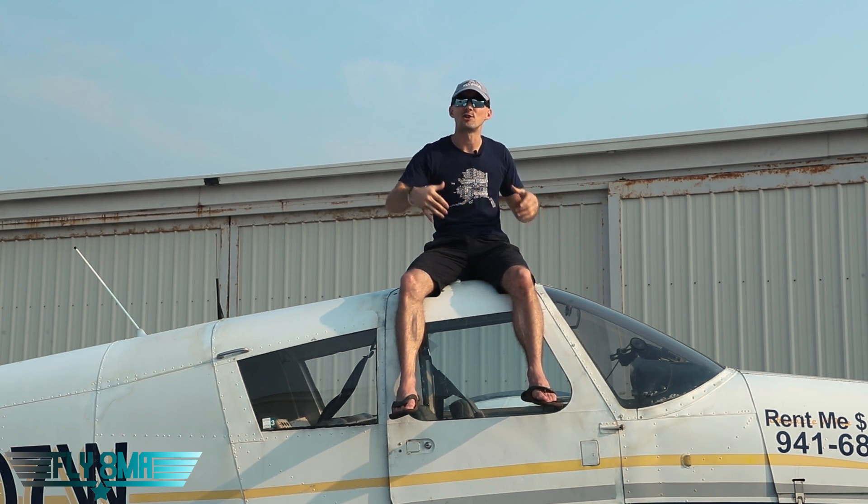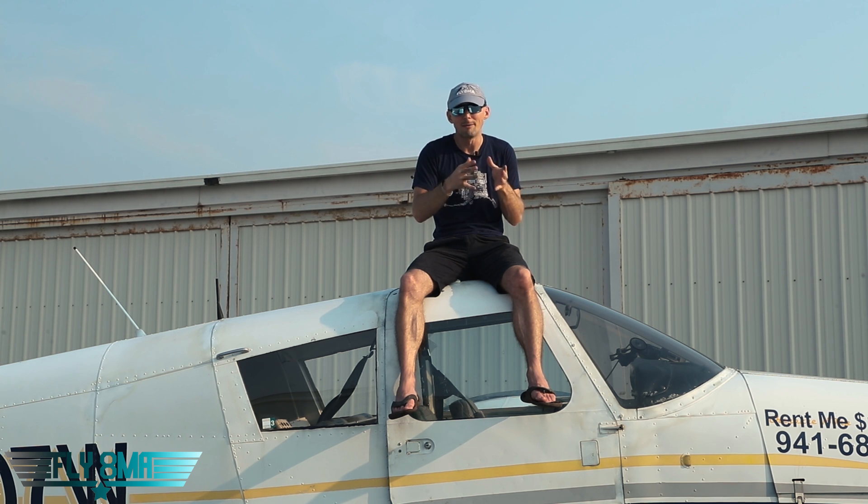I'm not saying to go out there and practice this because it is pretty hard on the aircraft. Bottom line: add more room for error to your stopping distance charts so you don't have to be ramming on the brakes so hard. Hopefully this video is somewhat educational — if you take away nothing else, it's that none of us are perfect. I can't go out there and perform perfectly on these brakes, and you probably can't either. Add some room for error to those stopping distance charts in your POH — 50%, even doubling the distance. Talk to your CFI about what they think you should do. Whatever it is, add something. Give yourself a large room for error.